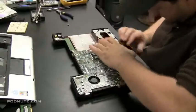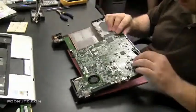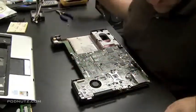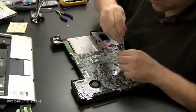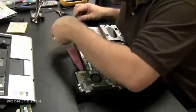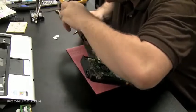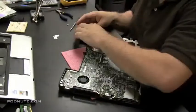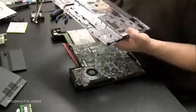The audio jacks at the front have got to snap through the holes — make sure all the holes line up and everything's snug. We're looking good; the sides are lining up and the motherboard's sitting in there properly. Now it's time to put the screws back. Thanks to the white arrows guiding us, there are only two screws holding this motherboard in. The white arrows will point to which screws you need to take out of the motherboard. Make sure that power jack is lined up with the hole — everything looks okay, so we're going to start putting everything back together.